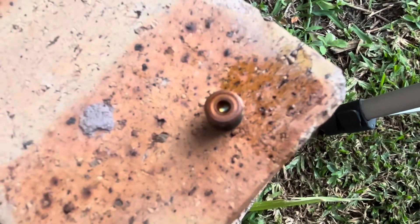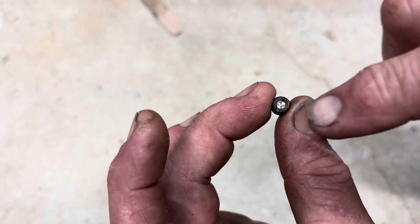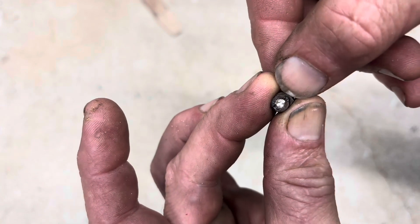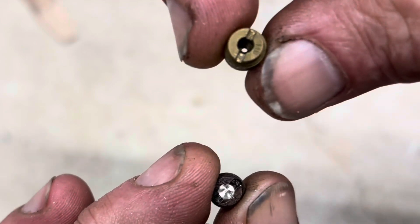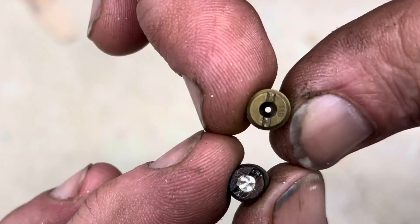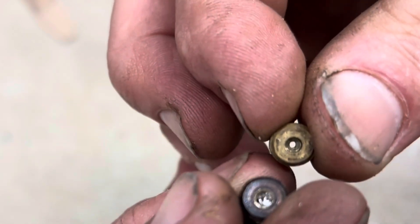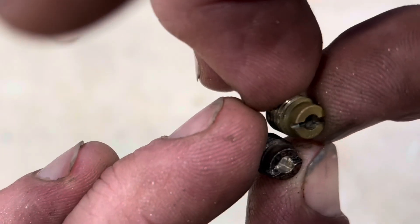That's probably it. So that's the bottom of the jet there — you want to be able to see the solder basically fill the whole hole. So now I've drilled the solder down to the height where the jet size hole is going to start. You can sort of see the standard one has a big hole down to where the jet hole itself starts. So I've drilled both of those back to where they need to be, the depth that they need to be.